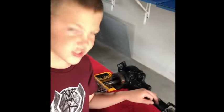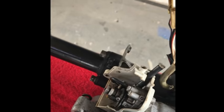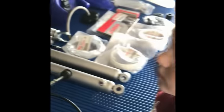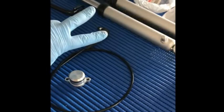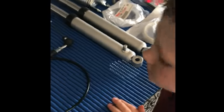We're gonna wash it with the steel brush. We tried using the degreaser but it didn't go as well as planned — there's a lot more grime in the corners. Importantly, we're doing away with the little two-stroke pump and we're gonna use this little insert plug. We also got the fuel cable — the throttle cable that normally splits into two where one goes to the two-stroke pump and the other to the carburetor.